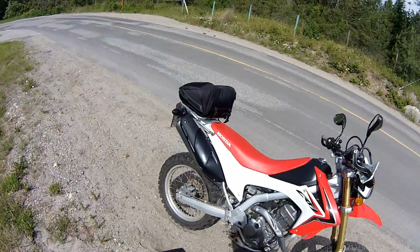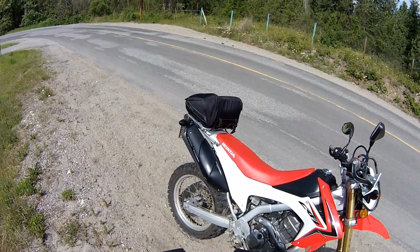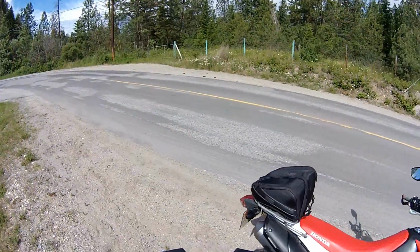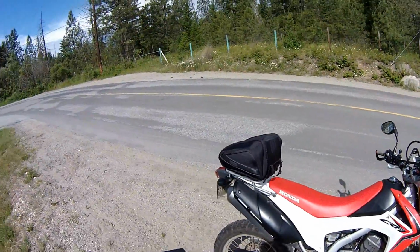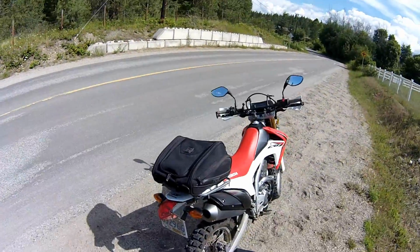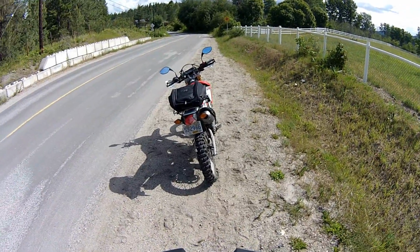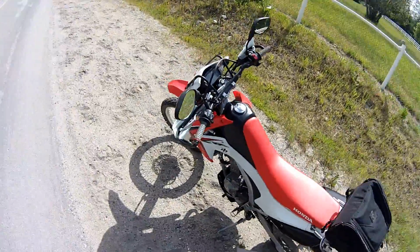So I think in future, would I get that type of tire again? I think maybe I wouldn't, because a dual sport is a compromise, and I really wasn't compromising, I was wanting the best off-road traction, but at the sacrifice to grip on pavement. And frankly, I'm going a lot faster on pavement than I will on dirt, ever. So where do I need the most protection, the most grip? Well, yeah, for my own safety, on pavement, right? So I think being a dual sport, maybe I should stick to a 50-50 tire and just suffer with a little bit of maybe not as good performance on really loose dirt or mud, that type of thing. But when I'm off-road, I'm usually going slowish, picking my way, type of thing.